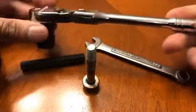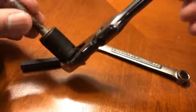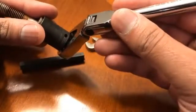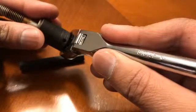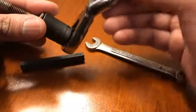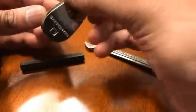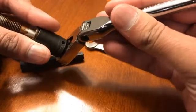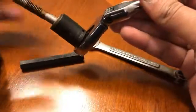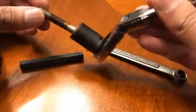It costs about 20 bucks and you can pick it up off Amazon. You need this because this bolt is up in there at an angle, and without having that flex head the shaft of the ratchet would impact either the lip of the upper oil pan — which is a gasket surface you don't want to damage — or against the other engine parts surrounding the crankshaft that hold the timing chain guide. So I cupped the gasket surface with my hand so that if the ratchet slipped it would hit my hand and not the gasket surface, and I eventually worked the bolt off.